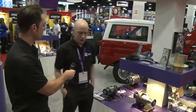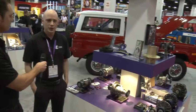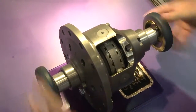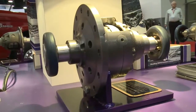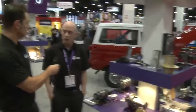Now we're looking at Yukon's Grizzly Locker. Grizzly Locker is a mechanical locking unit. It features a forged case and 8620 internals. It has a patent-pending internal design that reduces common locker failures you'll see out there in the field. We just dropped a couple of new applications — this one here for the Dana 60 and 30, 35 and 40 spline, and we also just dropped them for the Nissan Titan, which is the only full case mechanical locker for that application.